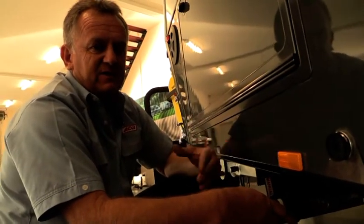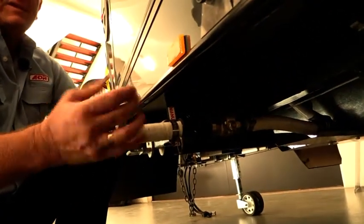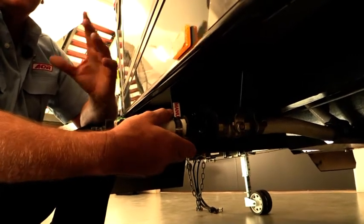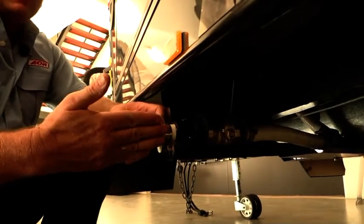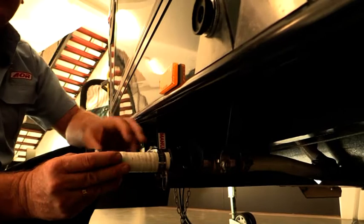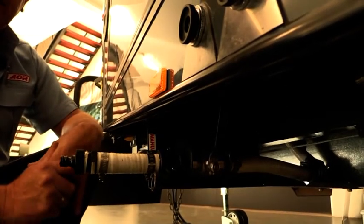It's critical that we do try and clean these regularly. We recommend every two to three empties of the black water tank when it's full to give it a good flush out — not an actual clean, but flushing out and cleaning the lines more than anything. Then after a few empties or going into storage mode, you might look at putting a detergent or cleaner through to clean out the actual tank and lines for a nice clean system for next use. This is a reverse flushing point as well as a drain-out point — it is a gravity feed, not through the pump. The only way to activate when this hose is attached for reverse flushing is to pump it out through our pump at the front on the drawbar. Then we would close our valve, push it back up, close that off, and we're now disconnected with the tank sealed back off and the pump turned off.